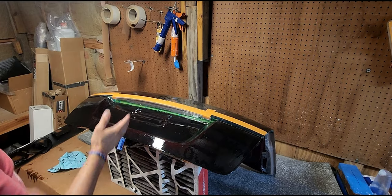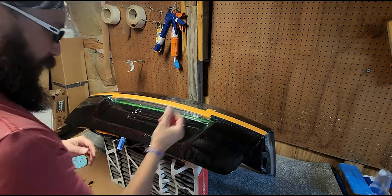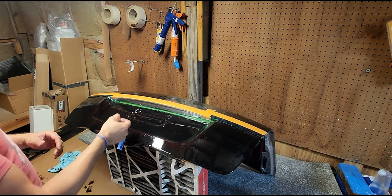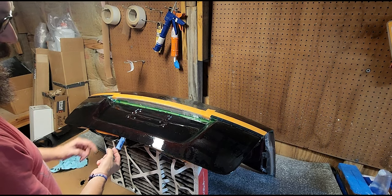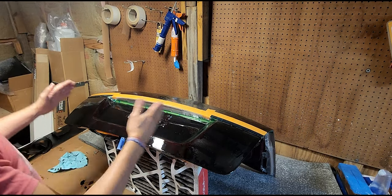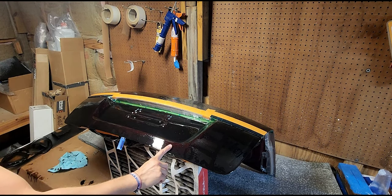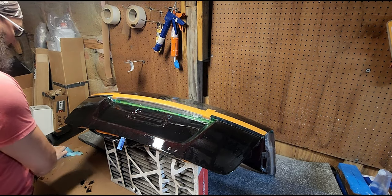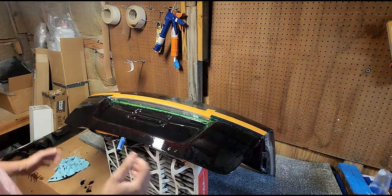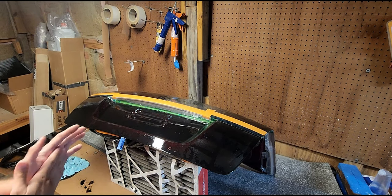So what I did was I found where the weave was real nice and lined up. So I marked the center point on the tape of the carbon fiber piece. I put out a piece of tape extension so I can know how far out to push it. So it's tacky. Usually they want you to wait until it doesn't stick to your finger. I like it when it's this tacky on a big piece like this because it allows me to move it around and still be able to peel it up without hurting the weave. So I'm gonna start.